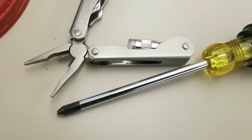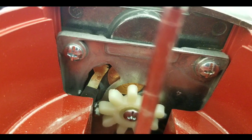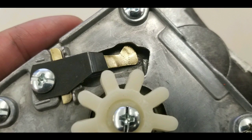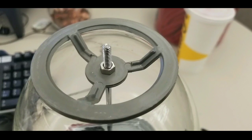Do it at your own risk, but just fix it. You need a pair of pliers and a pair of screwdrivers — a Phillips screwdriver is fine. What happened is that the tongue actually got smashed by whoever turned the dial too hard and basically got bent a little. So you're going to go in there and bend it back.